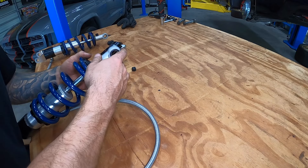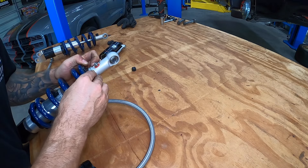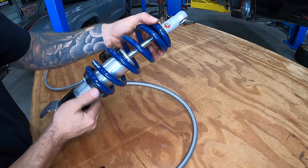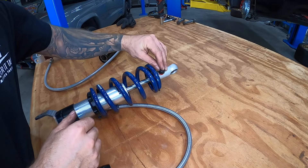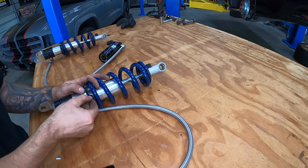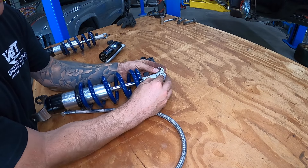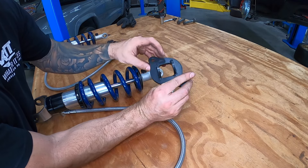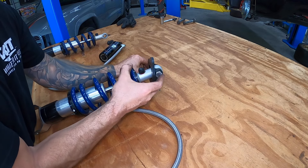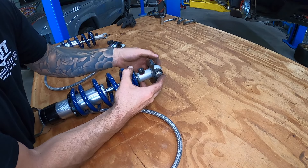This is the upper coilover mount for the rear — you'll see D for the driver's side and P for the passenger side. The way this fits is it goes in there, but we'll have to make additional clearance for not only the bracket to fit in but also your bolts with the head and the nut. I've already opened it up — I just clearanced it a little more with the grinder and painted it so we don't have bare metal. Get that done first before you mount your shock so you have this piece free, then clearance it so the bolts and nut will fit and all your bolts align.